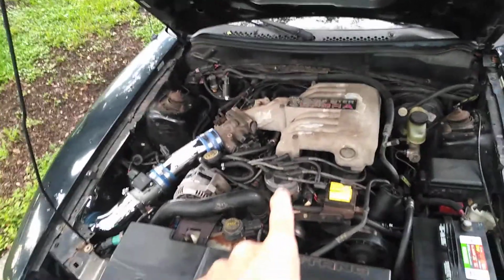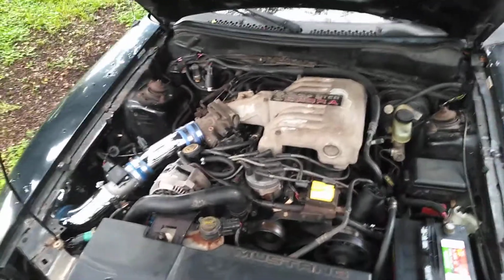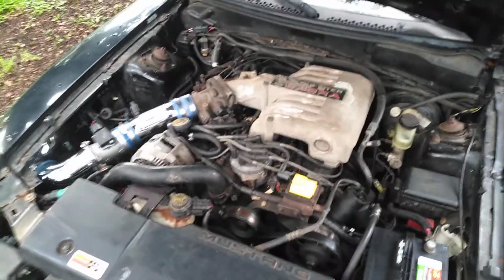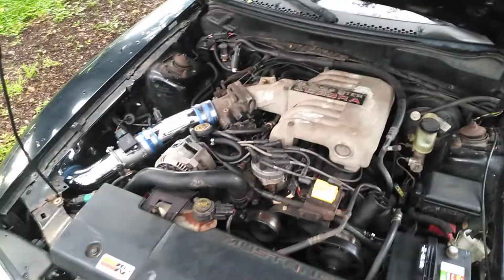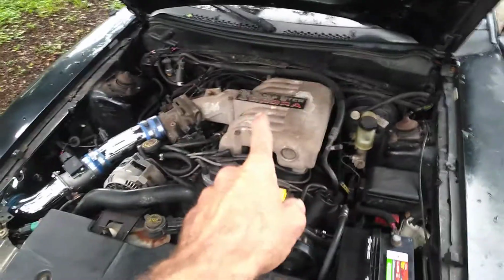Today, I'm going to get a ported out lower GT40 intake. Supposedly T-Moss did the port work. We'll see what's up, I gotta look at it. It's supposedly a stage 3 setup, total port work done to it. So I say 10-15 horsepower on that. I'm gonna take the other Cobra intake I got in the garage that came off a 95 Cobra, take that out. I'm probably gonna sell this piece and the other piece here.